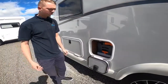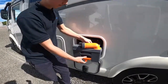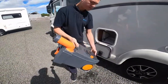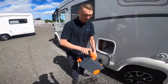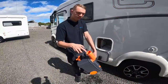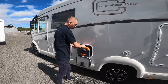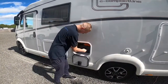Here you've got your cassette. To get it out, lift the orange handle and slide it out — you need to take your ventilation system off there first. Then take the cassette to your waste disposal point, which is normally beside the toilet block. Remove the cap, press the button at the back and tip the cassette out. Once tipped out, put some water in, give it a quick rinse, then put your chemical in — about 120 millilitres of either the blue or the green. Alternatively, if using tablets, put a pint of water in and drop a tablet down the toilet. Then reconnect your ventilation system and pop the cassette back in.